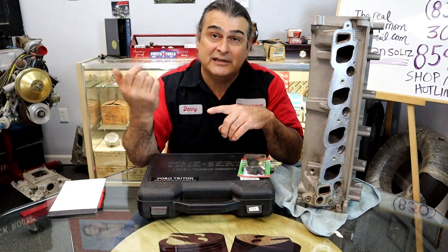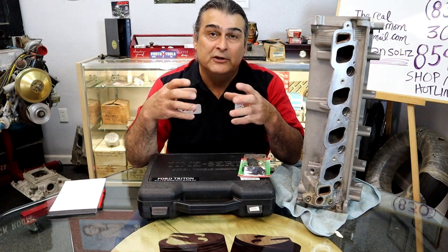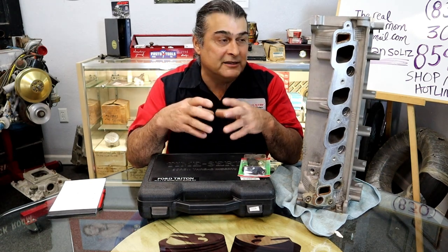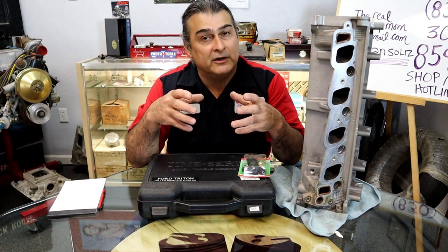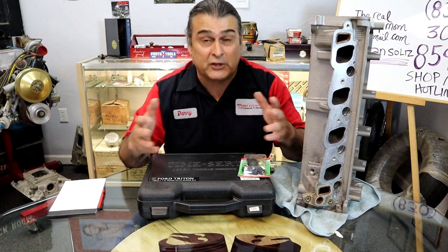If the ceramic does end up breaking because it's not wanting to come out, this would be a perfect time to use resonant frequency to shock the spark plug and let the vibrations loosen the crud that has stuck it in there. If we've done what we've just suggested, you may not even have to look at the rest of the video.